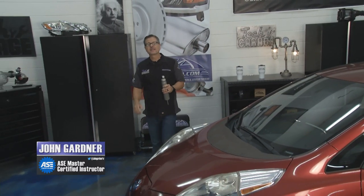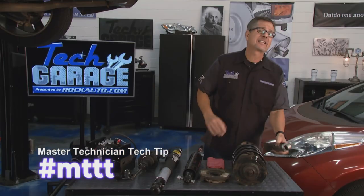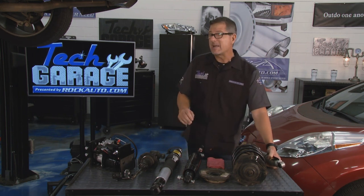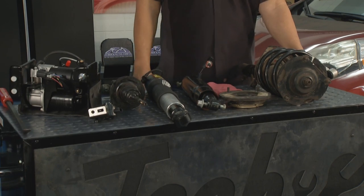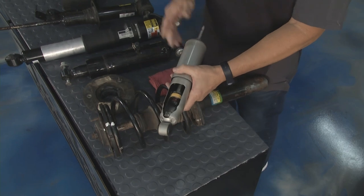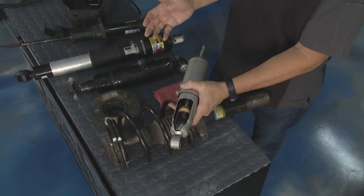Welcome back to Tech Garage presented by rockauto.com. We made it to our segment — the MTTT, the master technician tech tip. This time it's all about the shock absorbers. You know where most OEM shock absorbers wind up? The junkyard — and that's just not right. You should be changing your shock absorbers around 50,000 miles or wherever your manufacturer states. Let's take a look at them, see what they do and how they work. A shock absorber actually controls spring oscillations — that's its job. It doesn't control ride height; the spring does that.